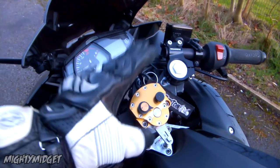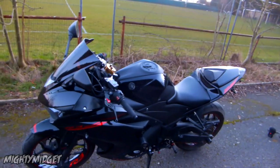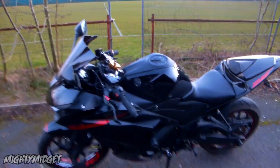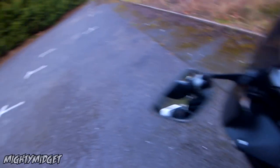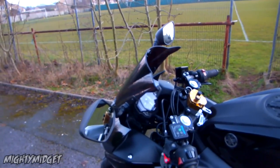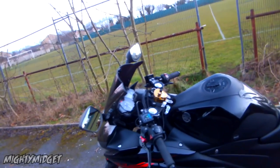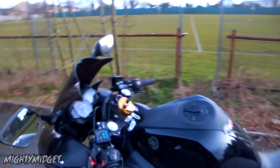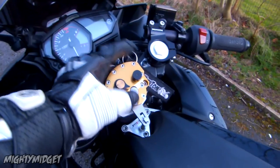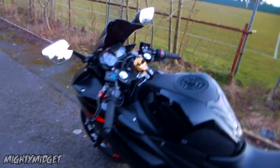Let's talk about this Savage steering stabilizer. This is awesome to have, especially if you do a lot of motorway riding. Because this bike is so lightweight, going on the motorway you get blown around all the time — it can be quite daunting. On maximum it makes you so much more stable. It's also good if you do wheelies — when you come back down you're not going to get tank slappers. For long twisty roads, turn it up a little bit; tight stuff, turn it right down. The Savage one is about 100 quid. The Öhlins ones are a bit more expensive. I actually wanted it in gold — I think it looks cool — but obviously it doesn't match the rest of the bike.